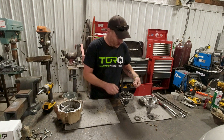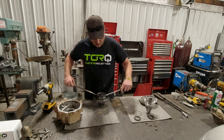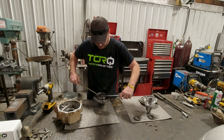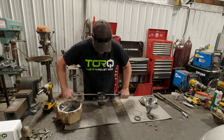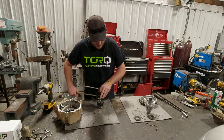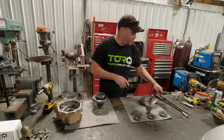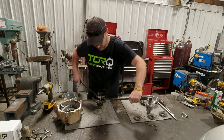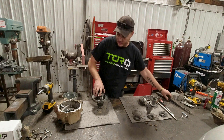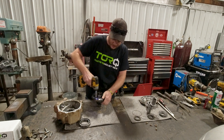Set it to the side. Now once again, this is just like the front axle setup. If you have shims, you have to reuse the shim. I'm going to take this tone ring - we're going to pry up on it evenly until we can get it to pop up. There we go - she's off. Same with the bearing, give it a little howdy-do. Switch over to the pry bar to get a little more leverage. Pop it right off easy. Set that to the side as well.